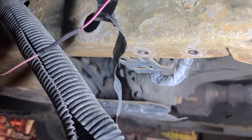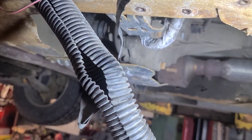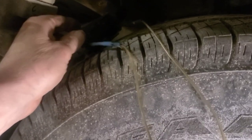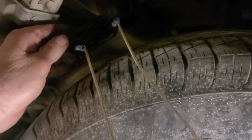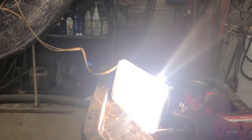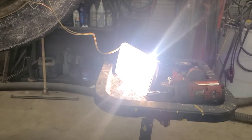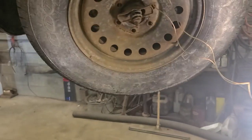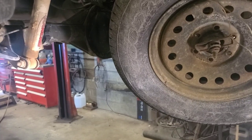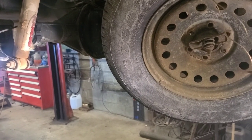I got the headlight connected across pins 1 and 13 and it's load testing fine. That headlight draws about three and a half amps — three to four amps — and it's a 10-amp fuse, so that should be a good indication that the circuit is good. We'll put this back together.